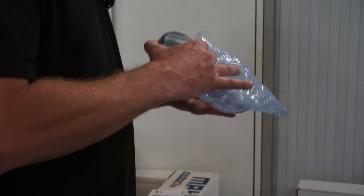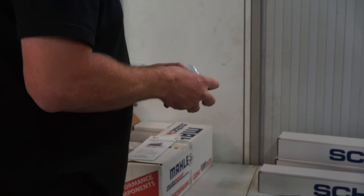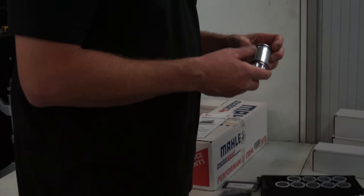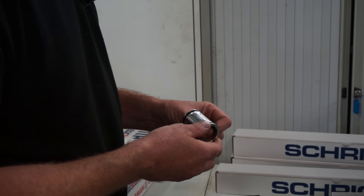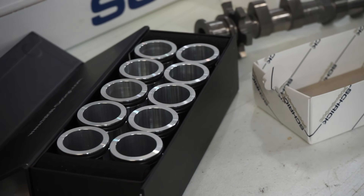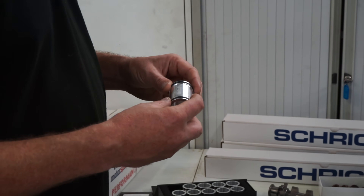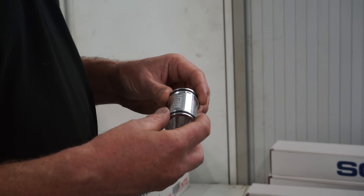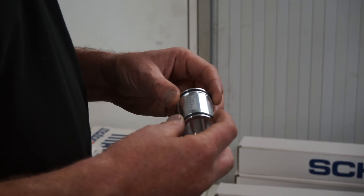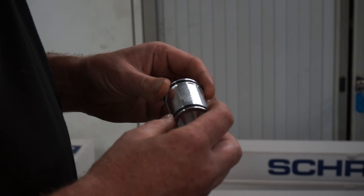Which is quite something usually for an S85. These are NRW spark plug tubes. So if anyone's had one of these engines apart before, they've got plastic spark plug tubes with a moulded-on seal on each end which tends to be a bit leaky as the car gets older. These NRW tubes are billet aluminium and they've got Viton o-rings that you can replace — just the o-rings rather than the whole tubes. So they're serviceable, but in theory you won't have to do that; they should last the life of the car.